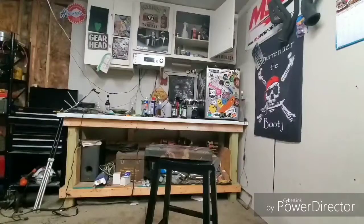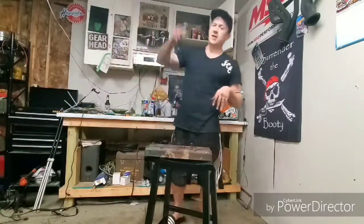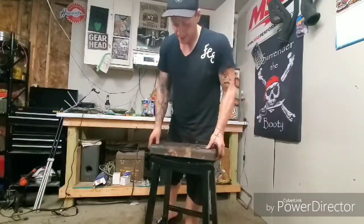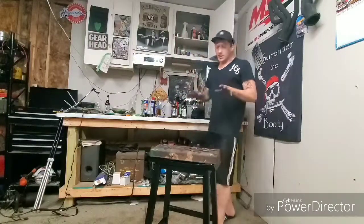Alright guys, so as promised, I am wrapping this video up. In between this video and next video, likely the only thing I'm going to do is just keep rotating that thing, make sure that valve stays moving. I'm going to go hit that with another round of wire wheel, and I'm going to do the same thing to the bottom of this head and probably the top of this head. After that, I'm going to get some gaskets ordered, and we're going to throw this thing back together. So you're probably not going to see this thing for a minute until I get some gaskets, because we're hitting the fuel pump, we're hitting the carburetor, we're hitting a bunch of stuff on the engine. So this thing will definitely be back.